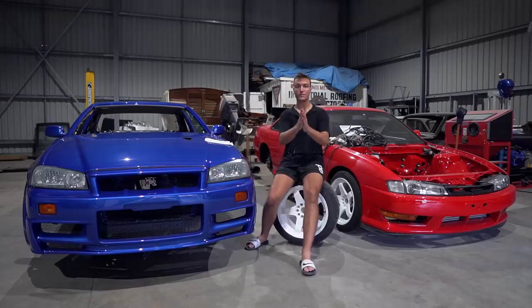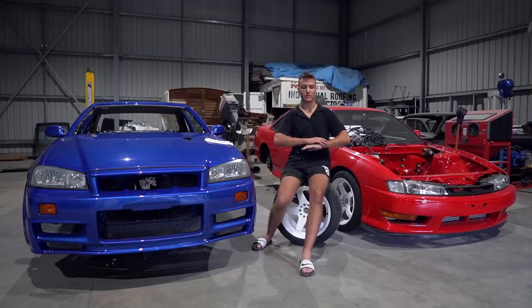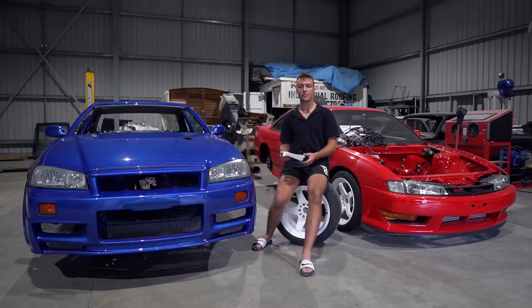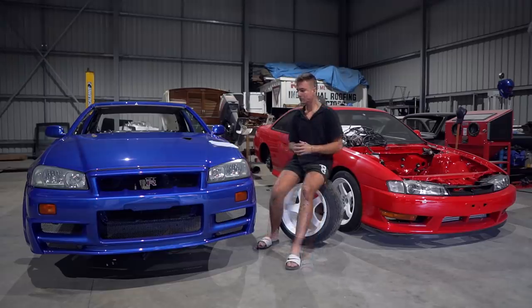The upside of the spray booth was good lighting, even though I did miss a few sections. Moral of the story: I wouldn't go to a spray booth again. I'd get a gazebo with some plastic sheets on the floor and just wing it — saves money and you can do it at your own workshop. One more thing to add: spraying two-pack paint in Australia is illegal unless you're in a spray booth, so keep that in mind.